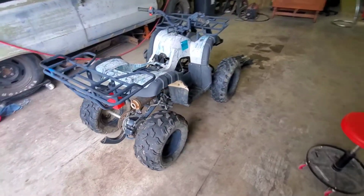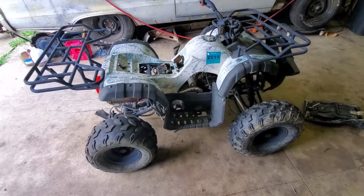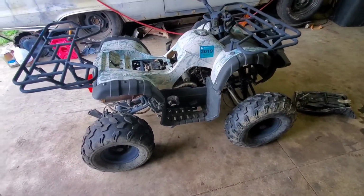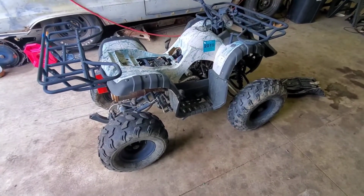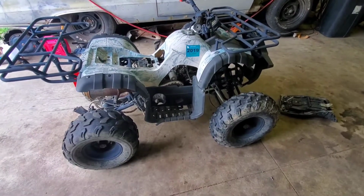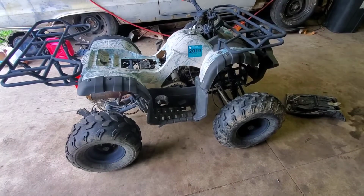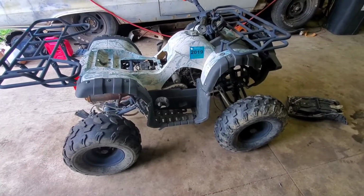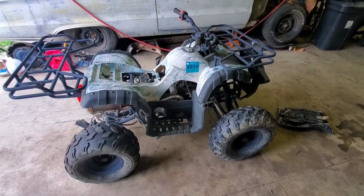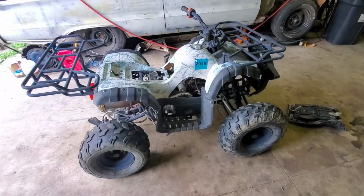So this is my middle son's, and the carburetor has been sitting, so we have to go through it. It'll fire on starting fluid and then just die out. I already got rid of the original carburetor that was on here and put a cleanable, maintainable, and adjustable carb on it. But since sitting, they don't last real long. So it is a little import Tao.